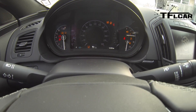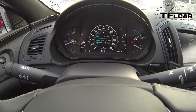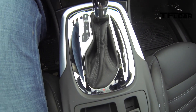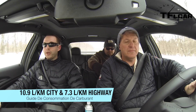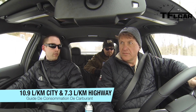You can sharpen up the car. So what happens if I hit the GS and sport button? Normally on dry pavement that sharpens up everything, makes it more sporty. The GS and sport button will alter the damper calibration, the steering calibration, and the all-wheel drive calibration. Essentially, when you hit GS or sport, we allocate more torque to the rear of the car and allow it to be a little more tail-happy. The big advantage is on dry pavement — you can push the car right up to its limits and keep a neutral handling demeanor. If you're in a corner with the throttle buried, instead of plowing the front end, it will track the line you intend to follow.